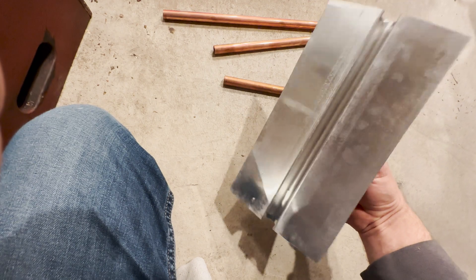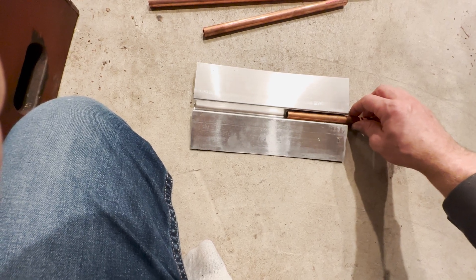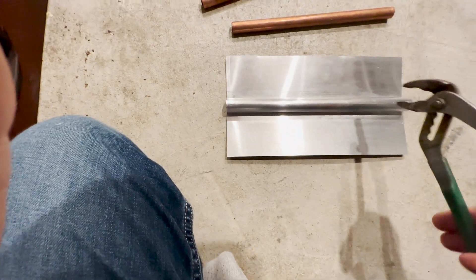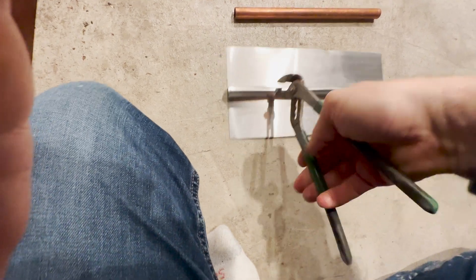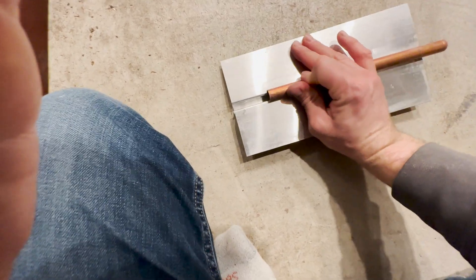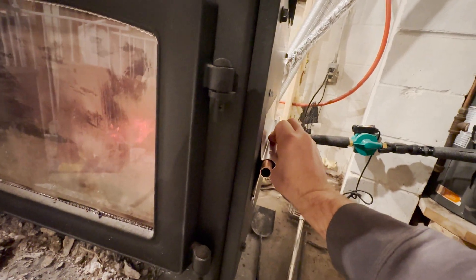Now these are designed for plastic tubing, so the plastic tubing is a little bit thicker — when you stick this in here you can see there's a lot of play. So what I did is I just took a channel lock pliers and clamped down to make it more flat, so I would get better contact on the tube. Then you just force this in and now you've got good contact. The other thing I did is I bent these — they were shaped more like that — so when it gets bolted on it actually pushes against the stove and I'm getting better conduction.